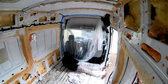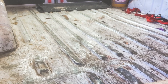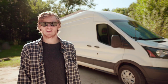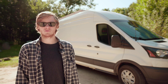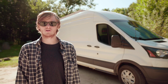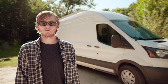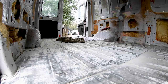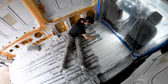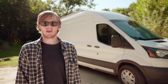Now I could work on the floor in the back. The floor was pretty banged up — it was dirty, the paint was super scratched up, and it was dented. The dents would be accounted for when I built the subfloor, so for now it was only time to address the first two. After cleaning the dirt off with some Simple Green and a brush, I decided it would be best to repaint the floor. The main reason was rust prevention — I would be building my own flooring over this floor but I don't want rust to develop on the metal under that. Having so much exposed metal where the paint was scraped away would greatly increase the chances of that happening. Before painting I first stripped it down by going over the whole thing with a wire brush attachment on a drill — this was slow and dusty work. After this I applied Rust-Oleum clean metal primer and then white enamel paint. And that was about it for the cleanup phase.